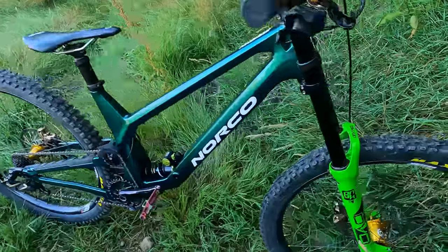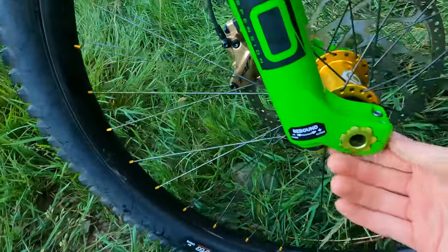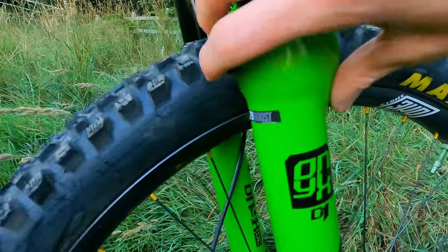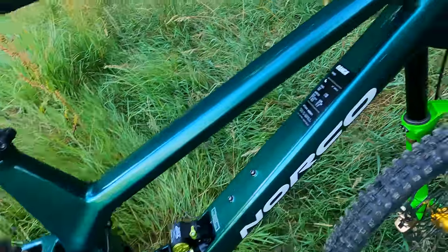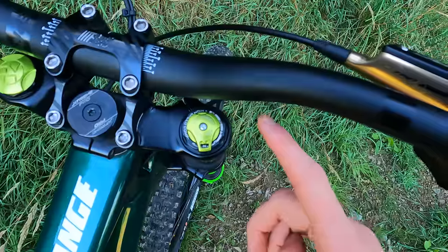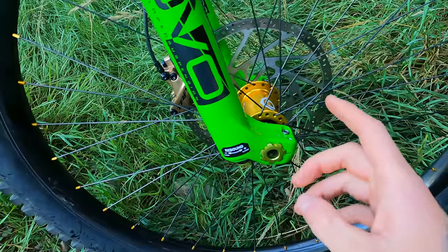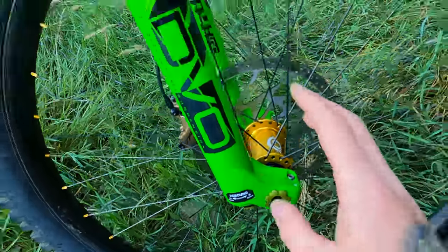Next, let's talk about these bad boys - the Onyx DCD1s, with a full 200mm of travel. They have all the bells and whistles: rebound, OTT on the other side, and pressure valves at the back for letting some air out. Of course, the triple clamp setup looks very unique on this enduro bike. I made minimal changes - I put in quite a bit of air up front, around 125. I left low speed compression at 2 clicks. I mainly messed with the rebound, as I didn't want to get kicked or have suspension too slow for the jumps.